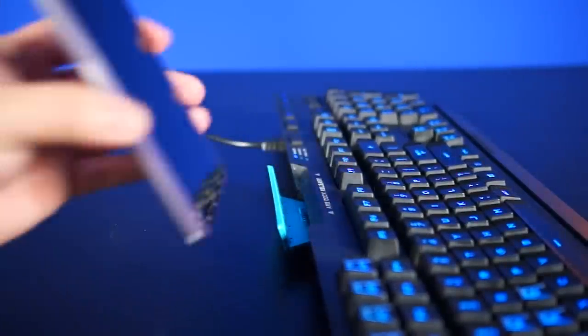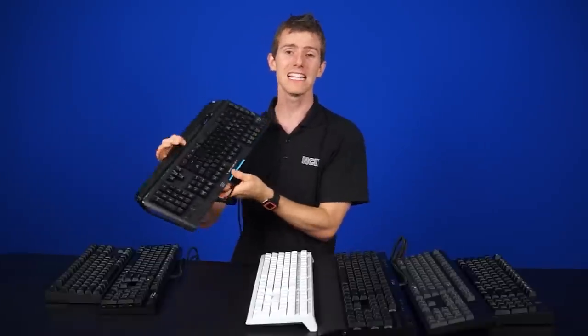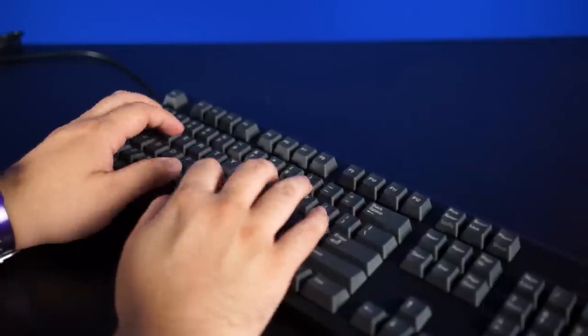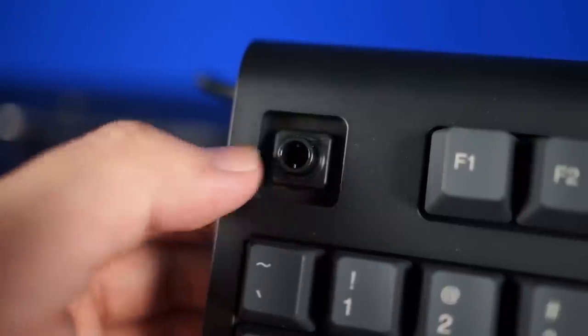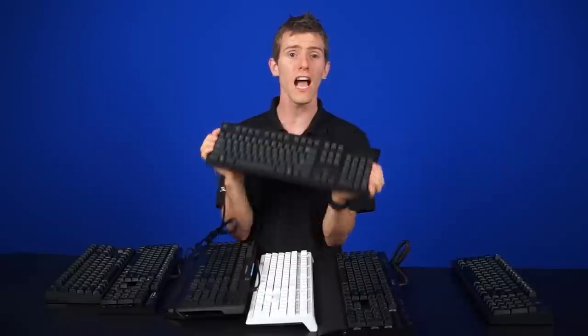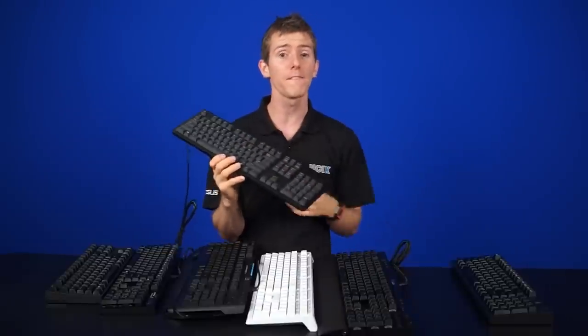Another cool feature of the G910 is the integrated cell phone holder, which can use Logitech's app to give you real-time feedback — a replacement for the classic flip-up screen originally introduced with the G15. With the Topre, it's probably hardest to describe the overall typing experience compared to anything else. The switches use a conical spring and rubber dome combo, which almost gives a membrane-like feel but with mechanical typing quality. If you get a chance to try one out at an NCIX store, we highly suggest you check it out before you buy. The downside with Topre switches is that you can't get custom keycaps and your keyboard options are fairly limited.